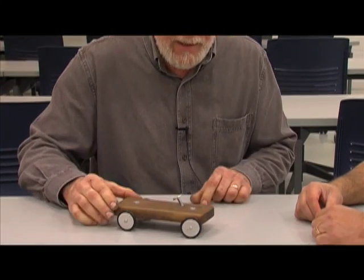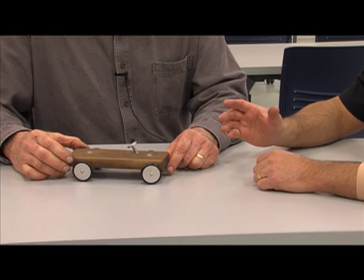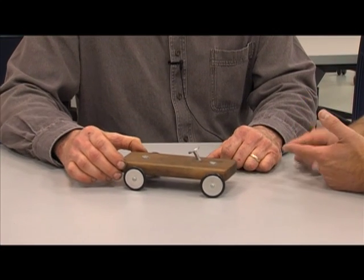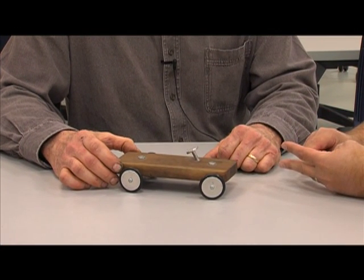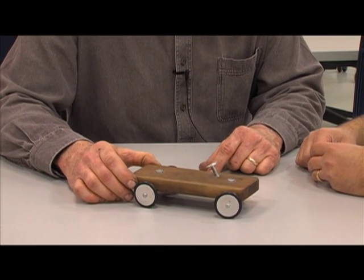Well, understeer and oversteer are the same things we deal with. It's just that we're not educated, so we just call it loose and tight. We got different terms for it, but it's the same thing. Understeer is when you turn the wheel and the car does not respond as fast as you want it to. Going into the corner, when you turn the wheels like this and you expect the car to do this, but instead it plows like a dump truck, we call that tight. So the car is pushing, or it's tight. Understeer, pushing, and tight are all the same terminology for the same condition. So basically, if you mess up, you hit the wall with the front of the car if the car is too tight.